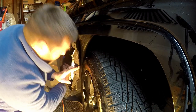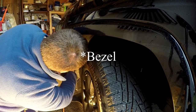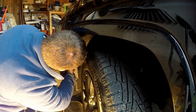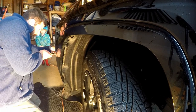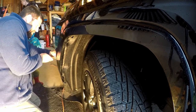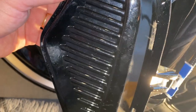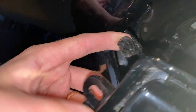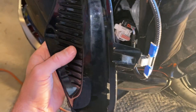Got that. There are just four or five tabs around the perimeter of this piece and you push those outwards to release the plastic insert. I now have the insert loose but there are a few things connected to it I need to disconnect. I've got needle nose pliers and it looks like I can do it from the front. I just have to release a couple of clips - one right here and another one on the bottom side - and then the bezel will be able to come out so I can put the new ones in.